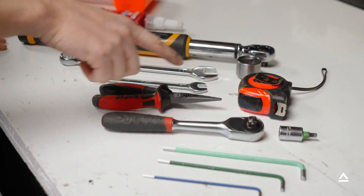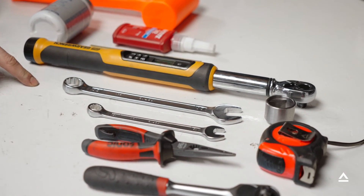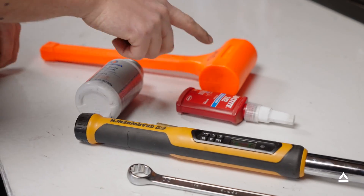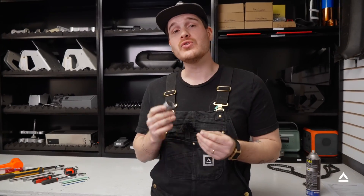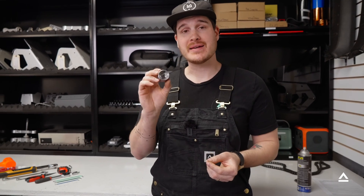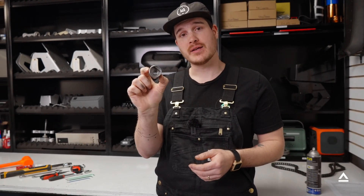You'll also need a pair of pliers, a good measuring tape, a 13 millimeter open-end wrench, a 20 millimeter open-end wrench, a torque wrench, a drift punch, some blue loctite, anti-seize, and a good hammer. One thing you'll need to ensure the proper torque specs during reassembly is our proprietary axle nut socket. We offer this on our website — click the link below to find this socket.